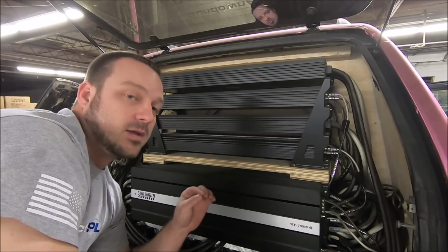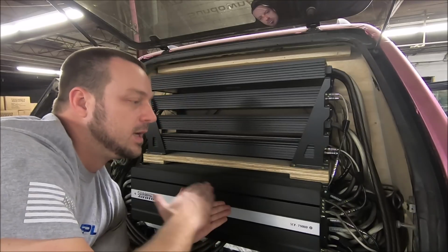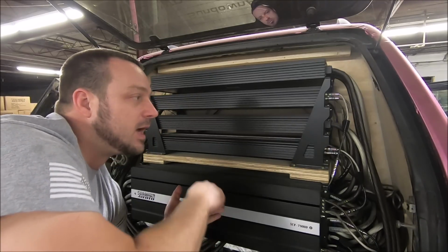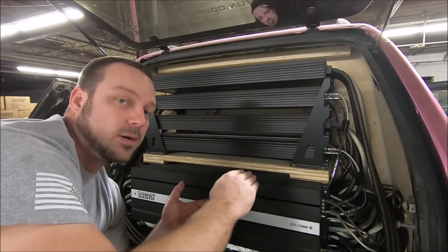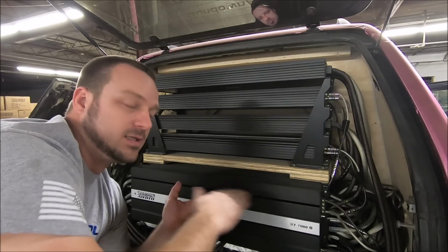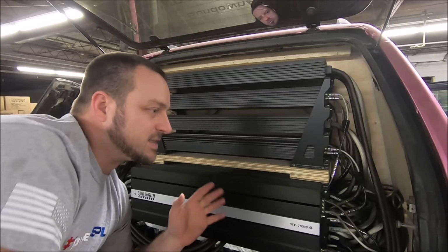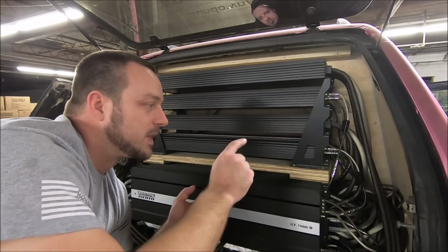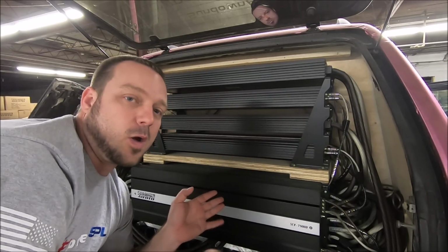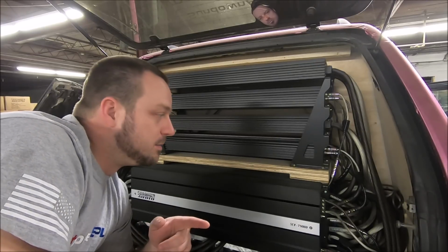Then I'm gonna pick the one that's the lowest. So take the lowest one, that's gonna be my baseline. I'm gonna go back to all the others that are above that, and I'm gonna back my gain down just a little bit to get them all to match. So give me just a second, because I don't want to make the video crazy long. I'm gonna just make a little note, write everything down, go through, turn these back. Be right back in just a second.